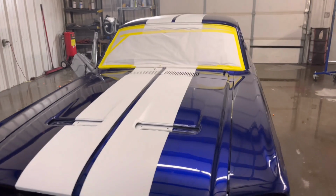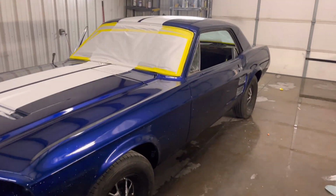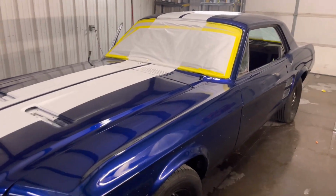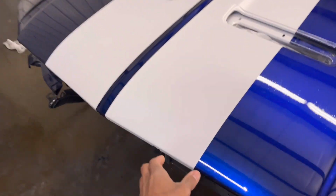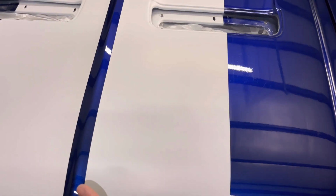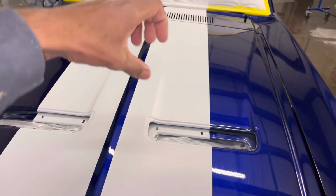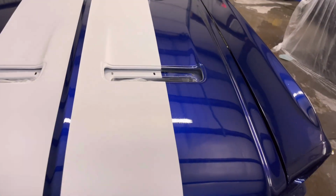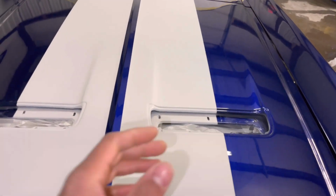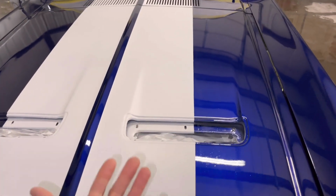spraying pearl, putting pearl in your clear coat and the mid coat, there is a very big difference if you do mess up. So the mid coat, what I would do, like, this is just the paint. There's no clear, no nothing. If we wanted to lay some pearl down, what we'll do is just put our bottle of blue pearl, dump it in our mid coat. We'll stir it up. We'll hit it about 2 or 3 times, and then that's the mid coat. Then we'll put clear coat on top of that, so it'll be laminating that mid coat.